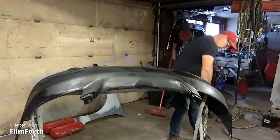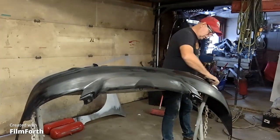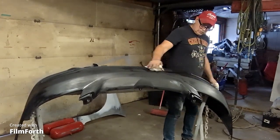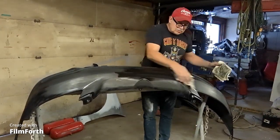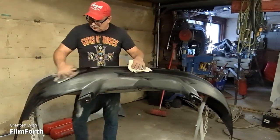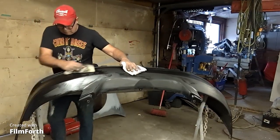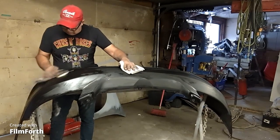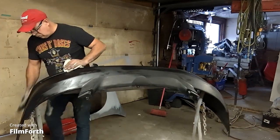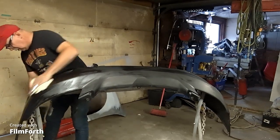The best place to get good quality used rags is Value Village. I look for all the terry cloth and washcloths and hand towels. They throw them in a big bag and they sell them for like $2.99. And I like rags that have lots of body to them, because they hold a lot of particulate. When you're washing something down, then your solvent doesn't just flow through it.